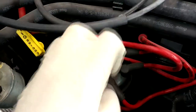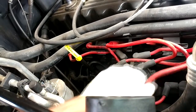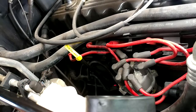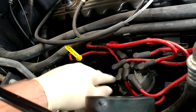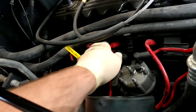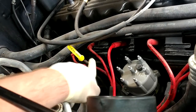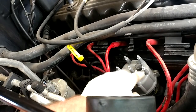At this point I can just rip all these off the cap. It might be a good idea to pay attention to which things are routed over and under — usually when these are put together right they go in a certain way so there's not a chance of cross-arcing through the wires if you have a problem. Same goes for all of our wire routing clips — just so whatever looks nice. Keep them separated from each other. We're going to leave all of our other ends of the wires connected for now. Let's get this cap and rotor off.